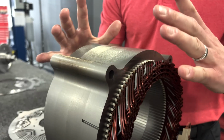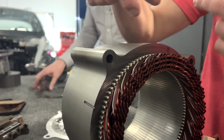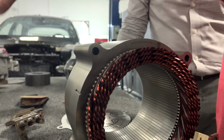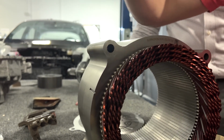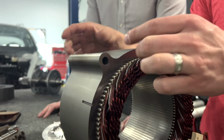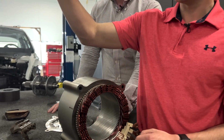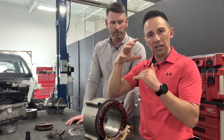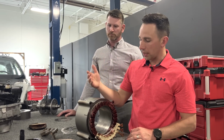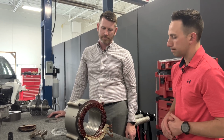And what that's doing is it's adding locally at this joint additional potential clamp load. It's distributing whatever those rotational load inputs would be that would ordinarily, without that piece, just go directly into these ears, and it's dispersing those along the top of that stamp plate on the top and through the casting in a more significant manner. So just like we were talking about with the gear drive units, that sort of cross-section, the larger tooth engagement, the bigger hubs, all of those things, once again, a pretty concerted effort for that torque management, to no surprise, looking into this.